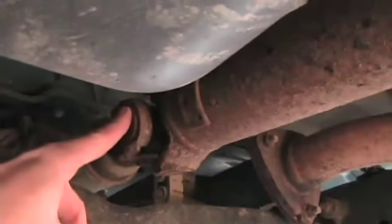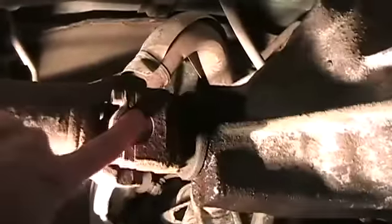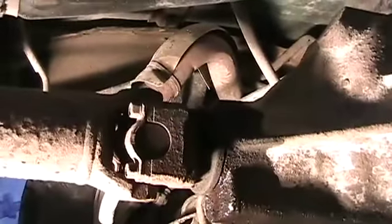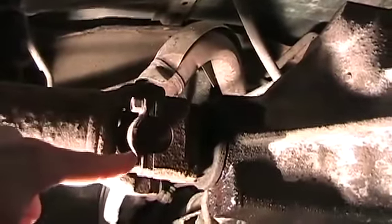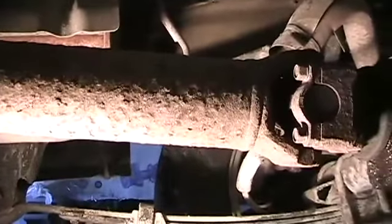I swear this is right up there with hitting my thumb with a hammer. Our drive shaft is right here, it obviously goes into the rear end. It's a pretty short shaft and it's got two u-joints on it — there's one up here which could be bad near the transfer case housing for the four wheel drive, and then all the way down the shaft there's another u-joint. Very easy to remove — undo these two bolts and two more on the side, a little prying action, the whole shaft moves forward and we can drop it and pull it right out.